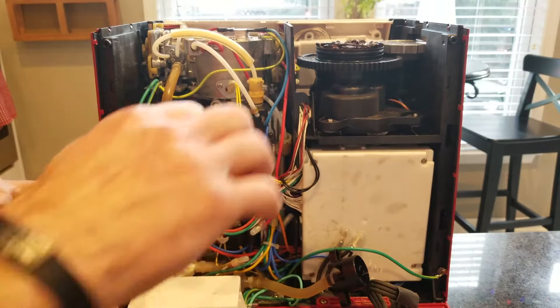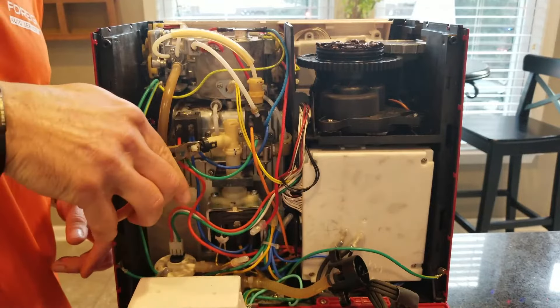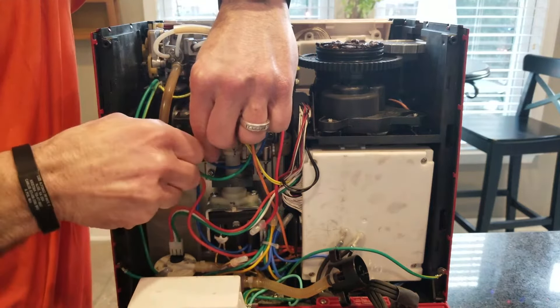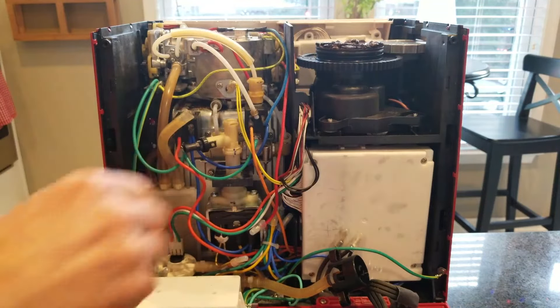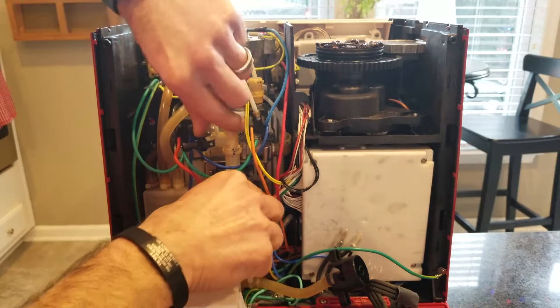This other connection is a little messier — you have to cut off the wire tie there, and then work the hose off the barb, just working it back and forth. It comes off fairly easily, and then you'll see the pump just turns free in there.